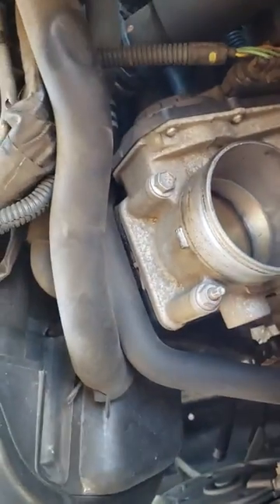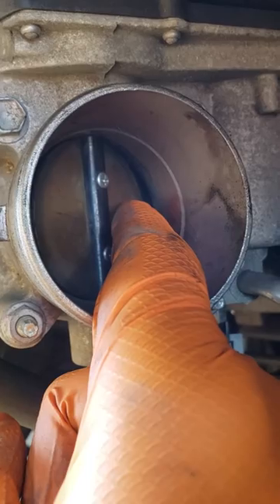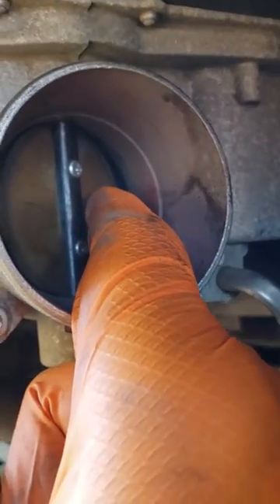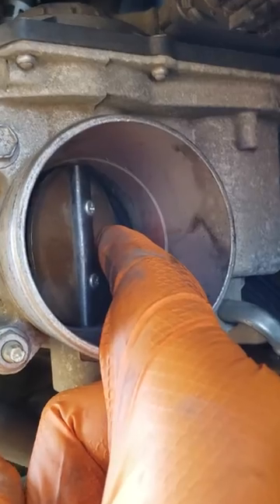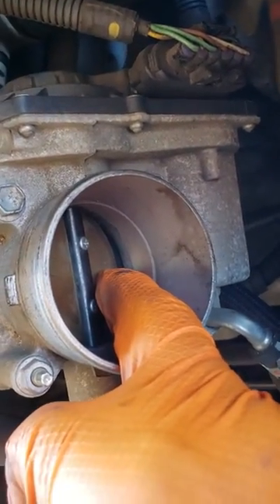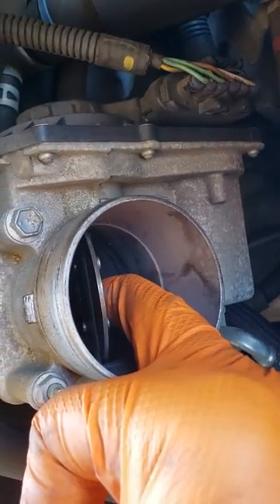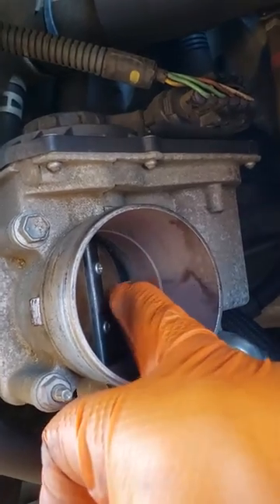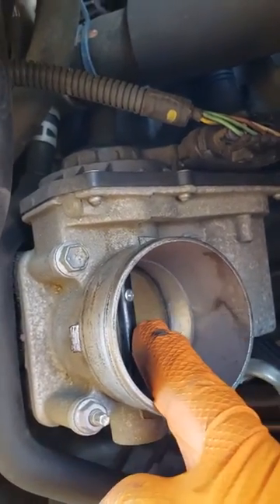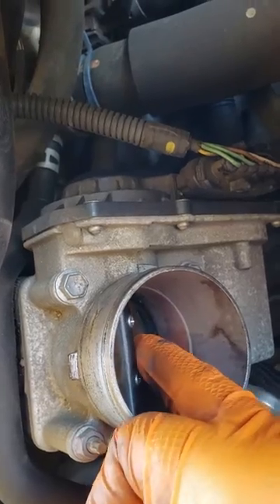Let me get my camera right. Here's what's happening. When I hit the gas — let's say I hit the gas — it opens up. Now, typically I'm just opening it this wide for an example, but it doesn't open this wide on takeoff unless you're really smashing it. But let's say it's open this far. When you really hit it, it's open this far. Now it's supposed to open up more to let more air in. But what it's actually doing is going like this when you hit the gas — it's closing and then opening up. So you'll hit the gas and then it'll go boom and then open up.